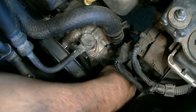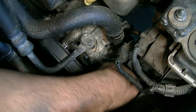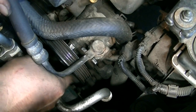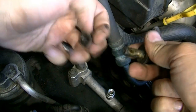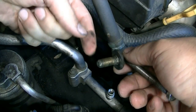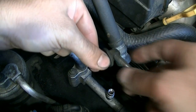There isn't going down enough to give enough slack, so I'm just going to remove the tensioning mechanism entirely. I already removed the 14 millimeter locking nut, now I'm twisting out the 12 millimeter tightening bolt. Now we can push the power steering pump all the way down and remove our belt. The tensioning mechanism works by going through the bracket for the power steering pump - as you screw in the bolt you pull the pump and tighten the belt; screw it out to create slack, then lock it with the nut.